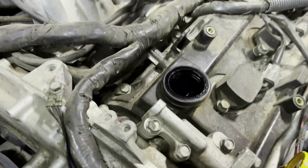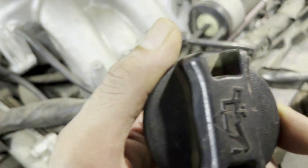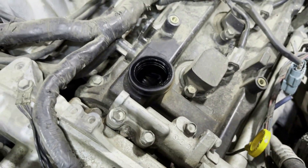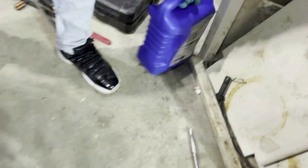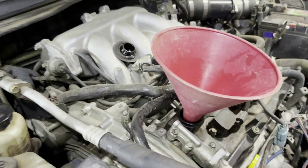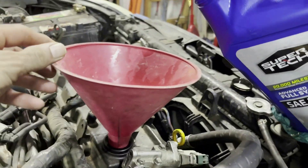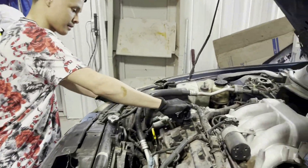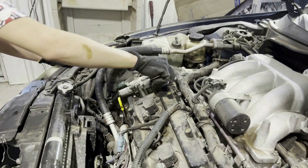When you put your oil in, your cap usually says what type of oil — it'll say 5W-30 or whatever. This one doesn't say, but I know it takes 5W-30, so we're going to go ahead and add that. This vehicle takes five quarts — I have it marked on there. Zaki's got the five quarts in. Go ahead and put the cap back on and we're going to jack it up and get the jack stands off.